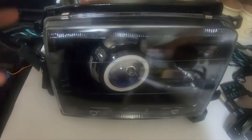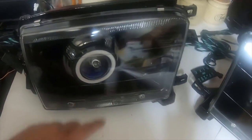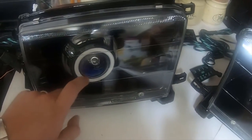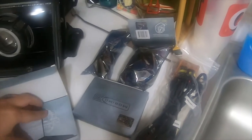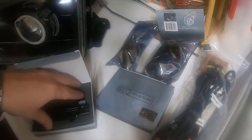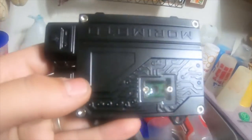You can set that up. These are Profile Prisms halos, Morimoto projectors, and TYC glass housings. I am running the D2S by Axion HIDs, 5500 Kelvin, so they're going to be a pure white.